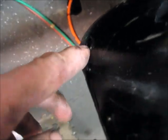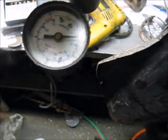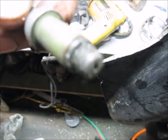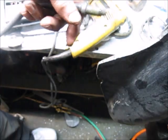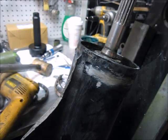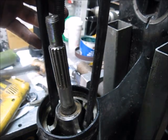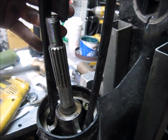Down here you'll see there's an oil port, and we've made a unit here - it's a Snap-on pressure tester kit for a radiator, and we've just put an oil fill fitting in it. We're just going to screw it in the bottom and bring it up to 40 to 50 pounds after I put the bearing carrier puller on it. Those of you who have never seen a bearing carrier puller - it would look something like this; well, it would look exactly like this.